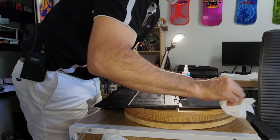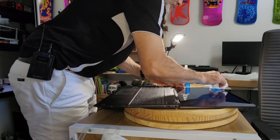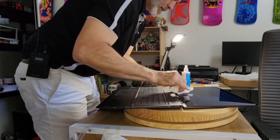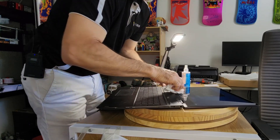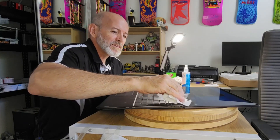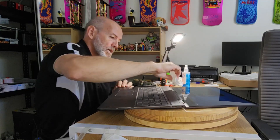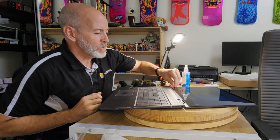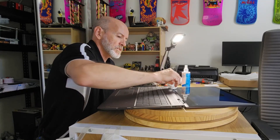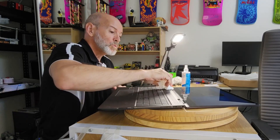If you don't reroute the cables correctly, you're going to have all sorts of issues, particularly along the bottom edge. If this is a two-in-one or flip-book style machine, once you flip it you're going to see if there's a gap there, and that's going to be frustrating. The client's not going to be happy. So while I'm doing this, I'll check — the Wi-Fi is still functioning. Check the things you've messed with. 5GHz connection, full signal — we are all good. Camera looks fine — no interference around the edges, so it's been aligned correctly.